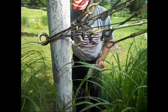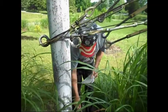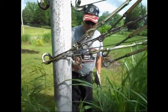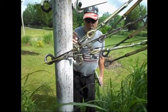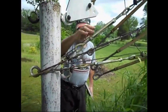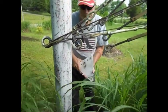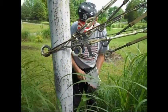So what you've just done is you've removed the... First thing I did was remove the pressure off of the torque plates, or the equalizing plates, and secured them using these turnbuckles here, and then removed the plates to be cleaned and painted. And of course I'll take care of the eye and around the eye. It's really not in too bad a shape.